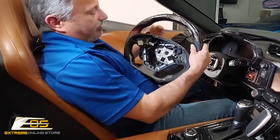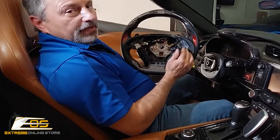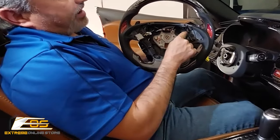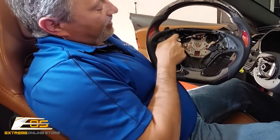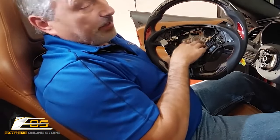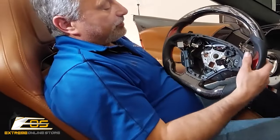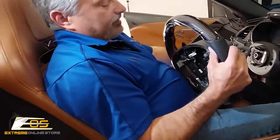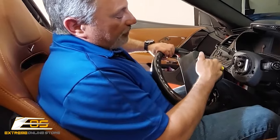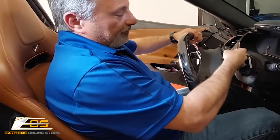We've got our steering wheel wire. Now one thing I did, but I didn't really point it out earlier, is that you want to make sure that you wrap your wire here around this slot. Okay, same thing on this side. This makes sure that you're not gonna get anything hung up here when you're trying to snap the airbag in place, okay? So what we're gonna do is take our wires here and feed them through our hole. So we're gonna feed those back through.